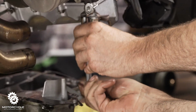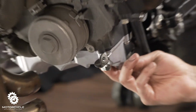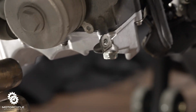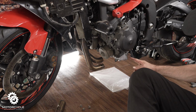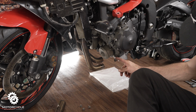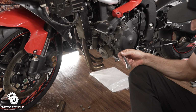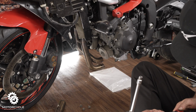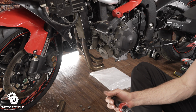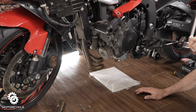All right, we'll get you those torque specs right now. So, like I said, it's not very much torque. Those two 8mm bolts under here that hold that sensor up are at 10 Newton meters. Each one of these Allen key bolts is going to be at 12 Newton meters. That's very little torque, and if you're going to do very little torque, you need to have a good reputable torque wrench. I use a Craftsman that's years old, but something that you trust and costs more than $15.